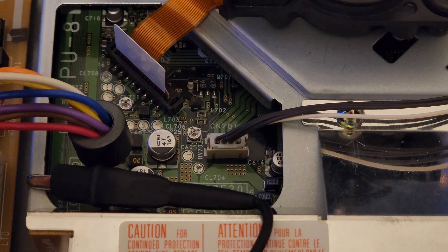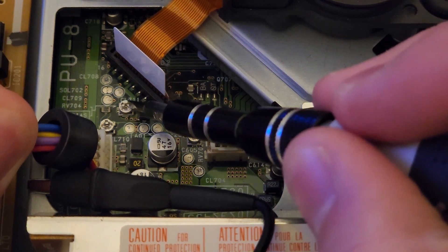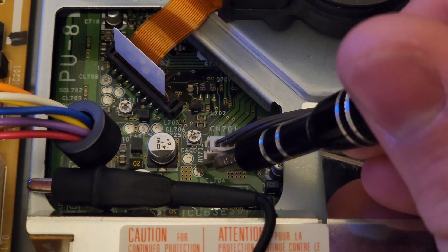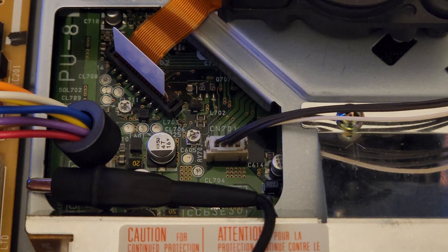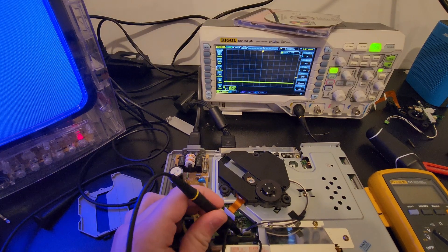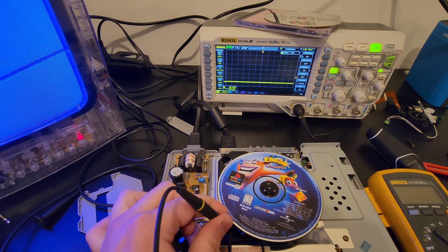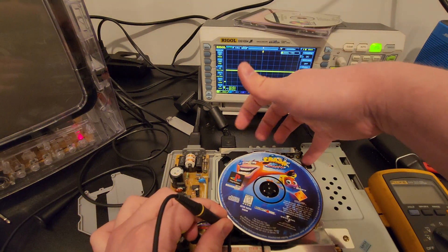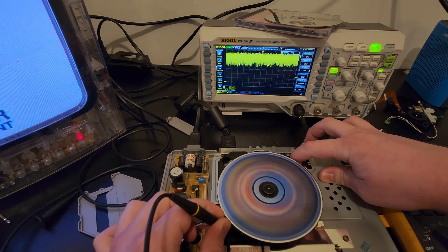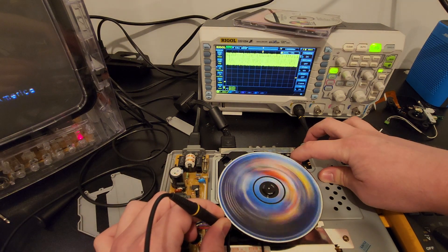Here is my current measuring setup. There is the CL708 test point — this is how you measure the laser bias and gain. And down here you have CL704, the other test point I've been using. This shows you the quality of the digital signal being sent out from the laser to the console, which then gets interpreted into data. What I'm going to do is put in a PlayStation disc and then measure down here very carefully. I'd recommend getting your oscilloscope probe onto the test point, disc in, hit the power button while holding the lid button. Now I'm getting some good looking data, but then once it kicks up — now it looks bad. You can see why the laser is making the decision to stop reading — the quality of the data just looks too bad.